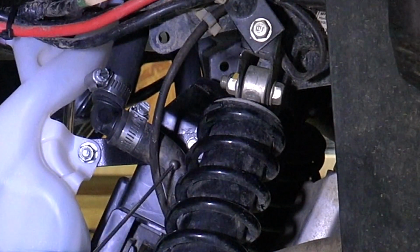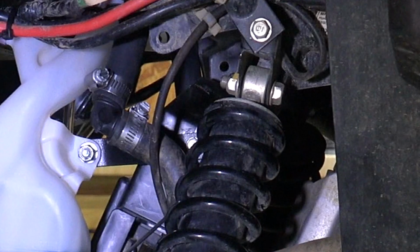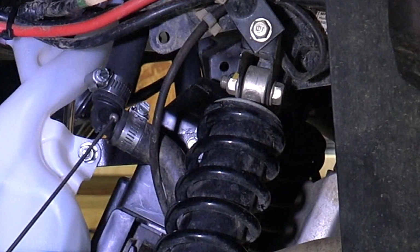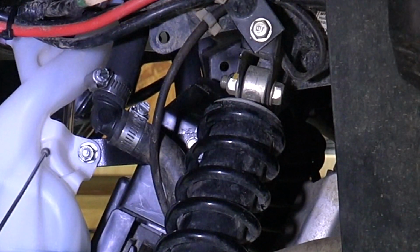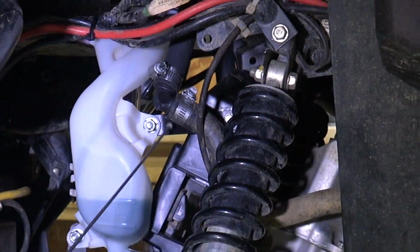If you remember earlier, I said we're going to have to swap the hose. This hose used to be inside this piece of frame rail right here. Now it's on the outside. We've got it zip tied secure. 90-degree elbow goes here to go up to the upper portion of the radiator. Here's your coolant recovery tank that is relocated with the brackets we were just discussing.